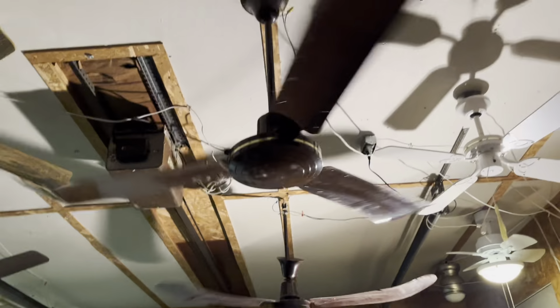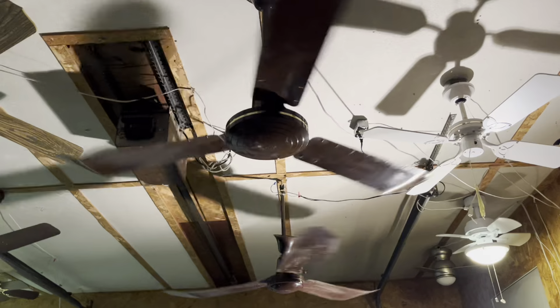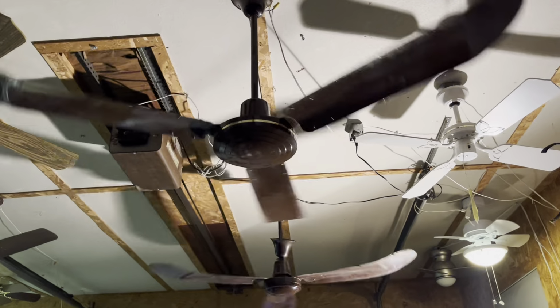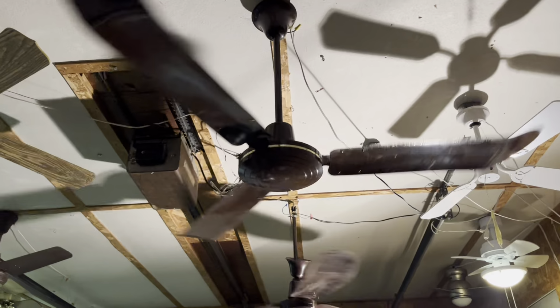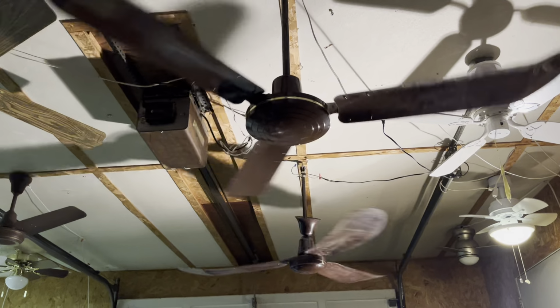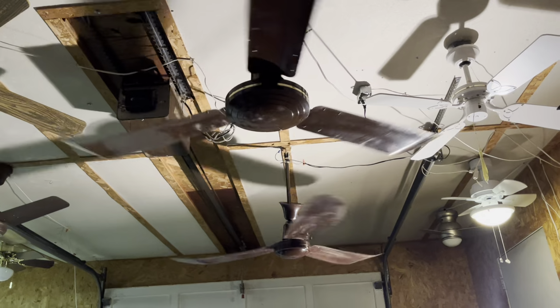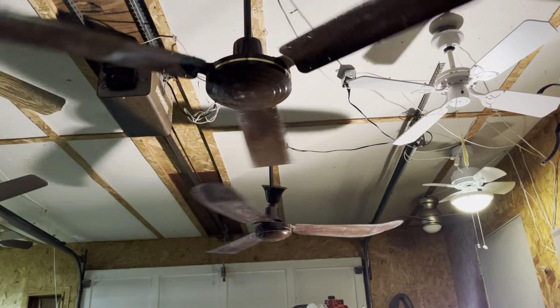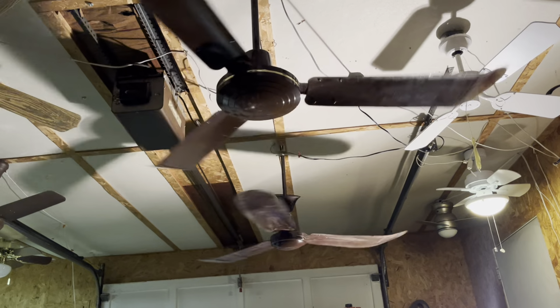But the bottom and the rest of the fan is still original, which is good because I'm glad the Contech canopy, the lower one, is still attached to this fan, because that's not one I'll ever find again, I bet. And ever since 1994, when this fan's from, I assume that's how long they've been running together. And I would guess just over the years of being on a Verispeed, the Canarm's capacitor was definitely starting to drift, and that's where the buzzing noise came from.